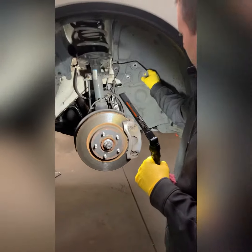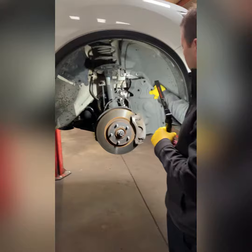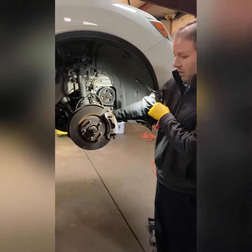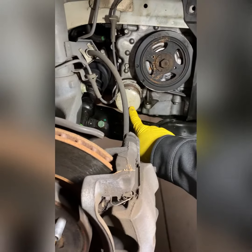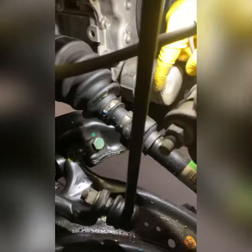Let's move in behind this right front wheel. This is just the plastic cover that mounts here that I've removed to gain access, because we noticed a lot of engine oil under here. Nissan places their engine oil filters right here behind that cover — that's the oil filter. You can see where something has hit, causing this oil filter to leak. So that's our culprit of the oil leak.